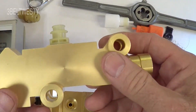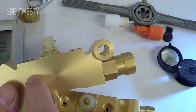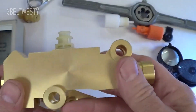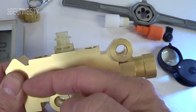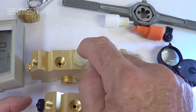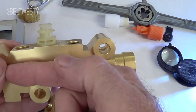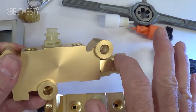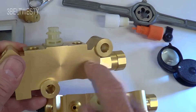If there's a major leak in the back end, the spool is going to move over and shut off the rear brakes. If there's a major leak in the front, the spool is going to move over — that's the dual brake safety system. Once that's happened, the light is always going to be on. To get this centered, you have to fix your brakes first, then have a bleeder open and hit the pedal to force the spool back over.